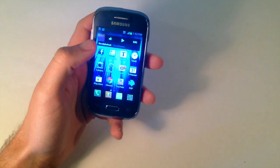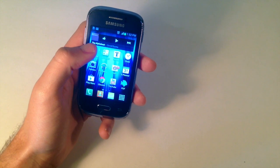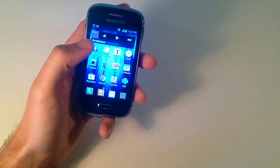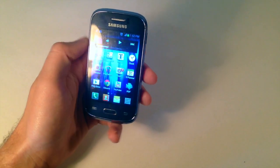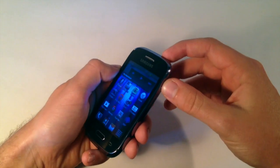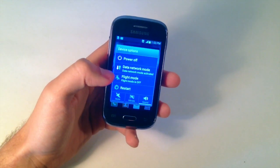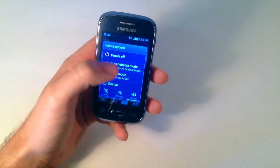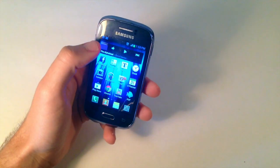This one is quite successful. If there's a glitch on your phone, or if there's any kind of bad apps running in the background that might be causing the problem, this might eliminate that glitch. So what you want to do is hold the power button for at least a few seconds, which will give you a prompt menu and you will be able to restart the phone.